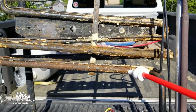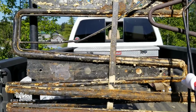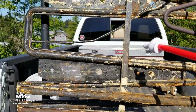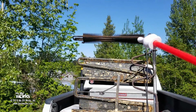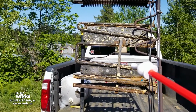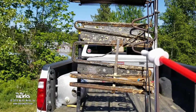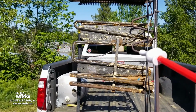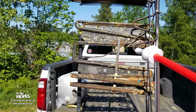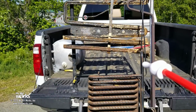So here we're done with our back and forth zigzaggy tubes. Different manufacturers do it different ways. You'll see that Norcold added an extra tube down here. But conceptually that's what's going on. So if I zoom out, you'll see that we went through our condenser. We got our zigzaggy tubes absorbing all that heat. Why am I absorbing it? Because I am vaporizing. Why am I vaporizing? Because of the pressure drop. I'm under pressure, there's a pressure drop, and I add the hydrogen in there to act as a thermal carrier of the heat. So now my hydrogen's being weighted down by all the ammonia, and right here we have this tube.